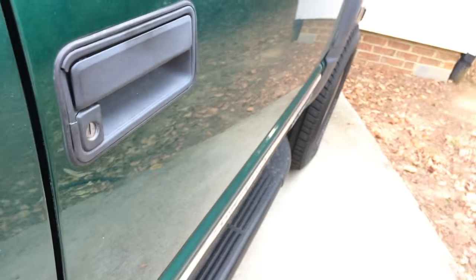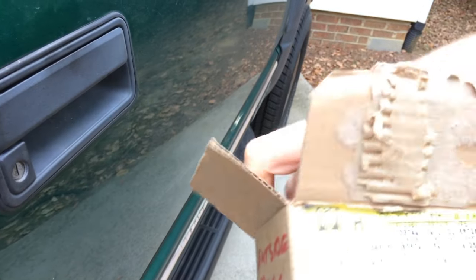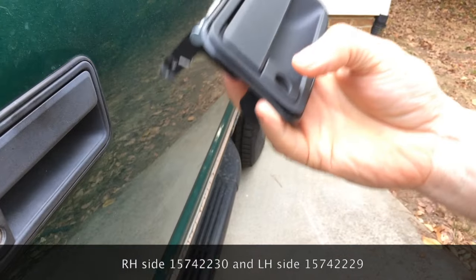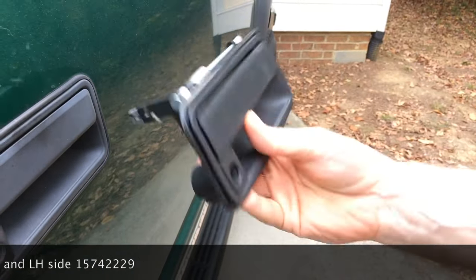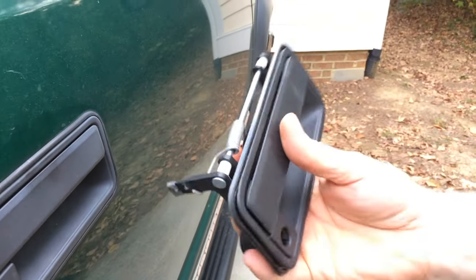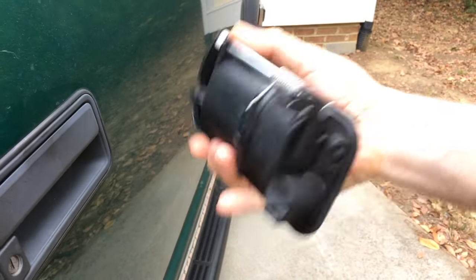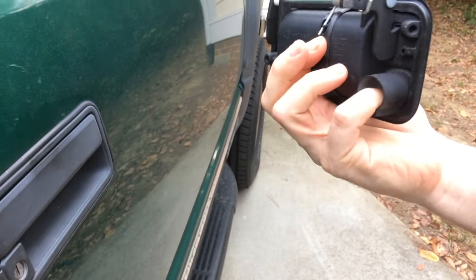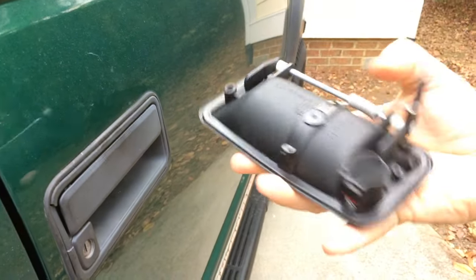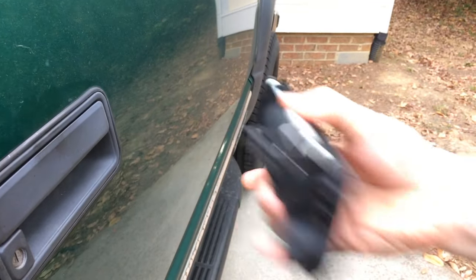These things go out, maybe every five or six years. What you get out of the box is going to be a whole new assembly that goes on the outside. The part numbers are for the right-hand side of the vehicle, whether it's the front door or the back door. I'll put in the description the other side, the left-hand side for the driver's side. Essentially, what we're going to be doing is taking off the trim on the inside, removing this, putting the new one on, getting the old lock piece retained, and then connecting back up the lever mechanism that connects to an actuating arm inside the door. Let's get started.